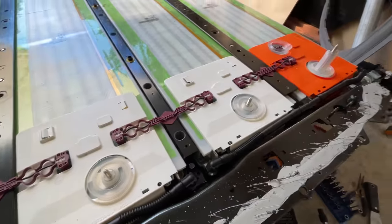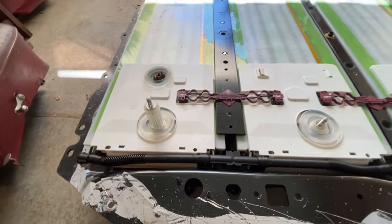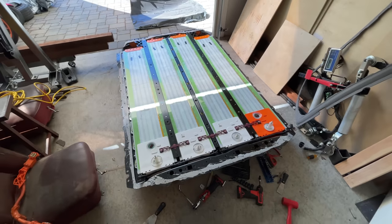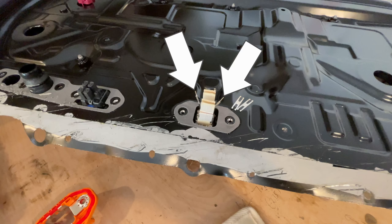So I'll just say that these plastic springy cable mounts are there to isolate the connections from, we'll say, cosmic radiation — and then I'll just wait for the correct answer in the comments. As a side note, I did try to fix this connector after I broke it. I had it working pretty well with some superglue and crossed fingers. The connector has these two small pins in the middle — this is the part for the high voltage interlock loop, the HVIL.